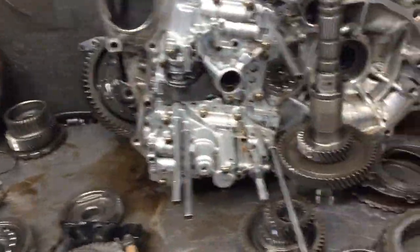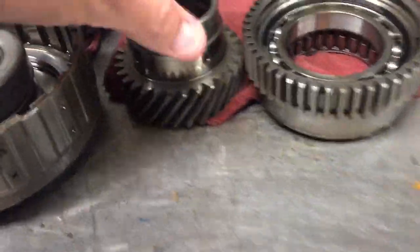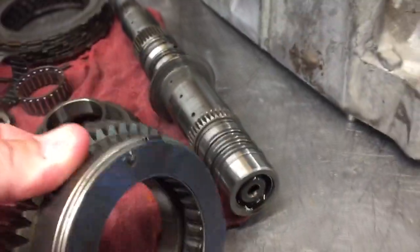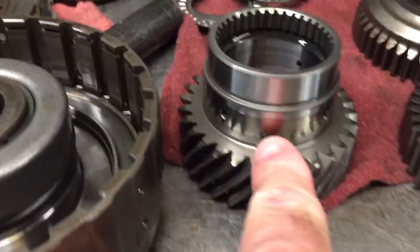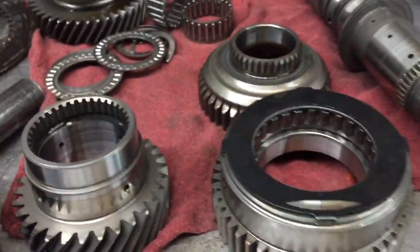Steels got chewed up a little bit. One of the other things we see is that these five-speed Honda/Acura transmissions have a low gear assembly that rides on the sprag, so when material gets in there and there's a lack of lubrication, we got wear on this component that's going to necessitate its replacement and also the sprag's replacement.